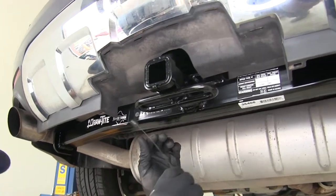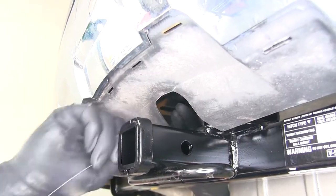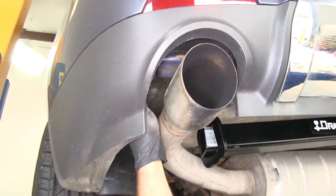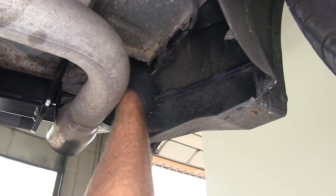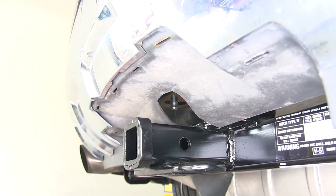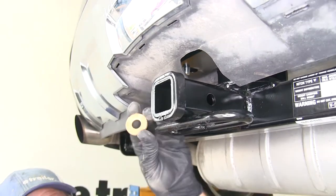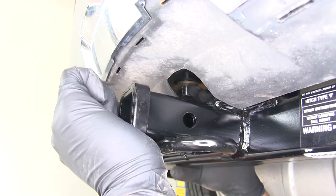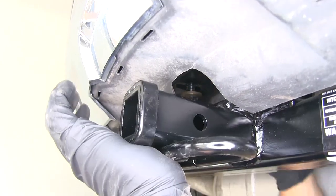Now we'll take our provided pull wire, place it through the hole in our hitch, guide it through the hole on the underside, and bring it out the end of the bumper beam. As you feed it through, you'll hear it rubbing over the top of the bumper and finally it'll slide out. Now we'll slide our spacer block up on the pull wire and thread on our bolt — I like to feed them in separately, then pull it on over. Bring that down through our hole and rotate your carriage bolt to make sure it's engaged in that block. We've got another conical tooth washer — place that over our carriage bolt with the teeth facing up towards the hitch. Then we'll thread on our hex nut, being careful not to push that bolt back up in or you'll have a tougher time getting everything started.